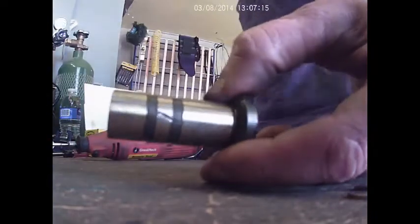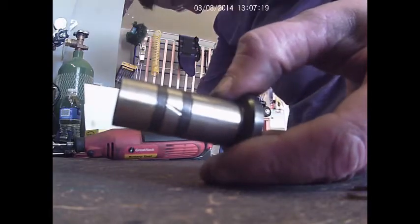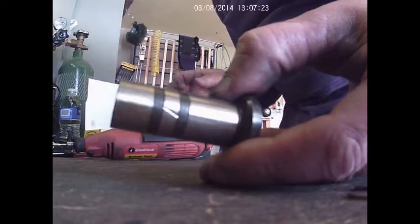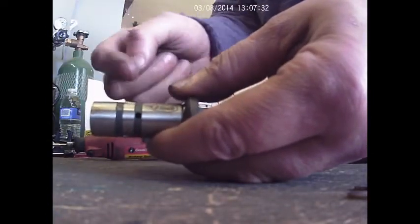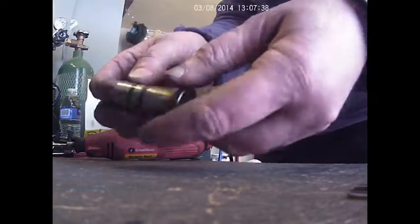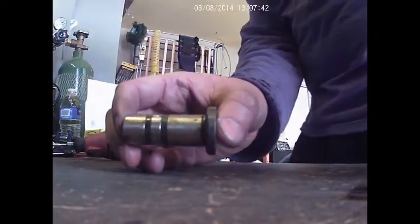Now, it's very important that you grab some sandpaper. And you sand the burrs off, because otherwise if you put that in your engine with any burrs, it's going to destroy the little cylinder this goes into. So you want to sand it with a 400, real quick, get those burrs down, deburr it, and that's it, you're done.